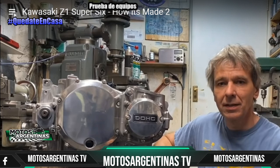With the starter motor cover fitted, it's time to make the extending cover at the back, which I'm going to make out of 1.5mm thick stainless steel, using these 2 pillars in the centre to hold it on with 2 screws. So the first thing I need to do is get a piece of cardboard and make a template by inserting it underneath the starter motor cover, drawing round the profile at the end of the starter motor cover, then rubbing around with my finger to make an impression on the card, which is going to be the profile of the engine casing. From this, I can transfer that size across to a piece of stainless steel, cut it out with my tin snips.